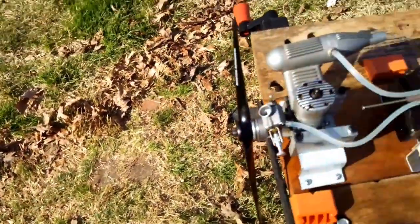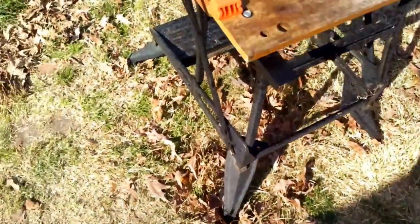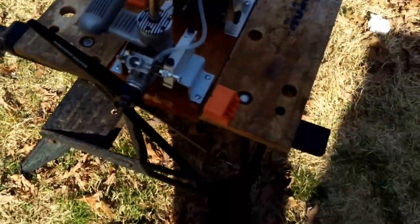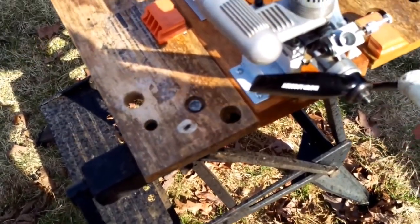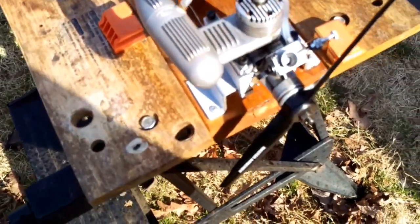Smelling castor. So I backed out of it when I did that, and you could hear it tell like it just wanted to take off. So it's just not broken in yet. That ring is still seating. And you could tell also it was running rich, and it was what, 12,300, something like that. I'll take a look at the video. I can't remember myself. So we'll see if we can get better idle.